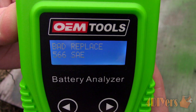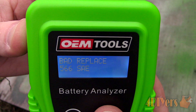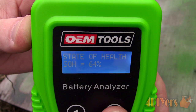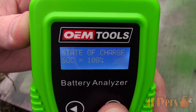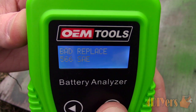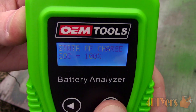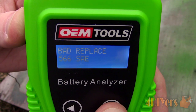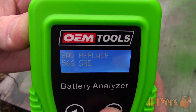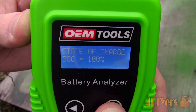The final result shows a faulty battery. The battery is only able to provide 566 cold cranking amps at its current charge. State of health is 64% and state of charge is 100%. Internal resistance is 6.36 mOhms. Resistance does have importance in a battery — the older a battery becomes, the more resistance it may have, indicating it's coming to the end of its life cycle. However, resistance varies based on battery construction, number of plates, and temperature, which is why it isn't a commonly used value for determining battery condition.